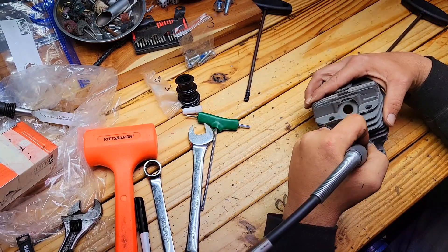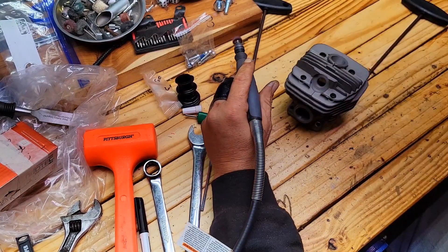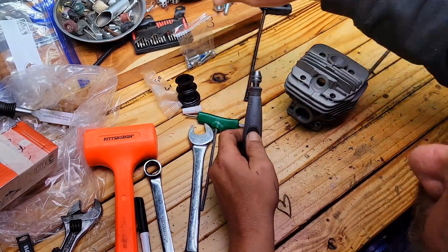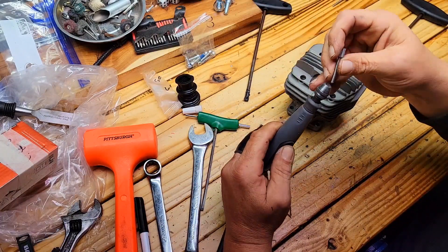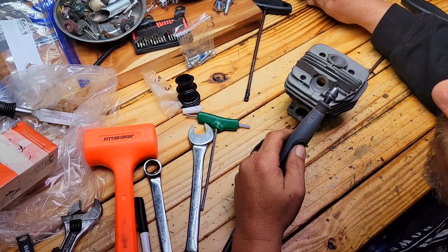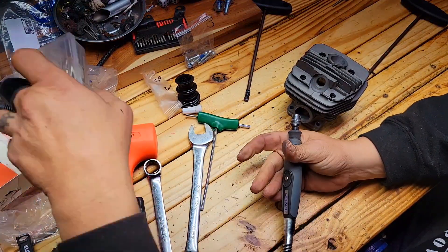So I'm cleaning up my intake a little bit. I was whittling in and giving it some rough texture where it could help fuel dispersion — so as the air and fuel come through there, it kind of disperses a little bit. I make grooves in there, but I also clean them up at the end so I don't get any casting debris in there.